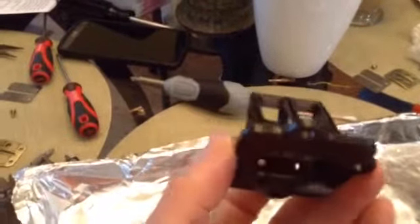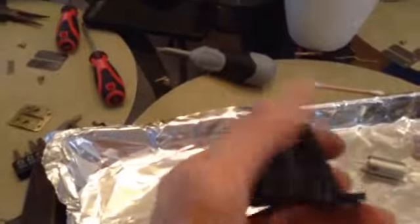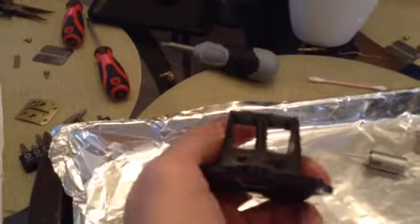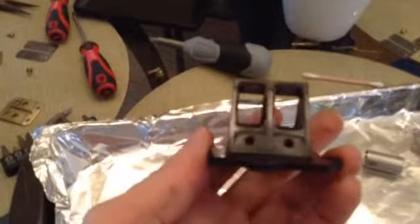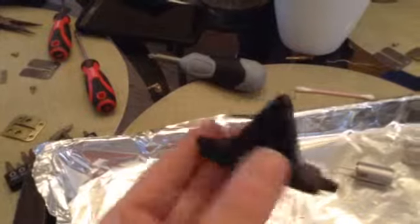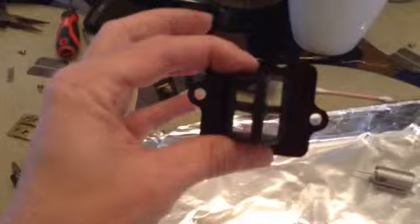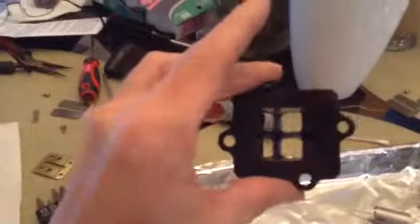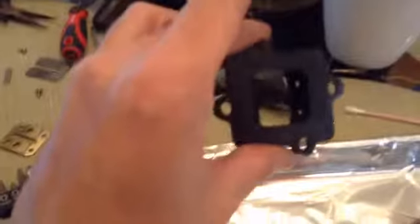But anyway, I also sanded on the top here, as you can see. I just basically looked at the reed to see where I could let more air in when it opens up. And sanded that with a little sand Dremel thing. And this side I didn't do yet. I probably would have liked to remove the bridge altogether, but I took out approximately,